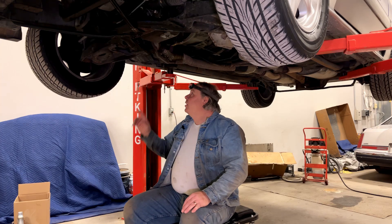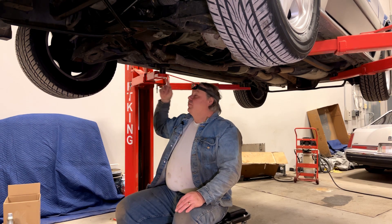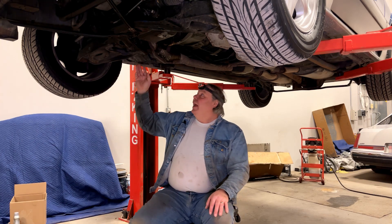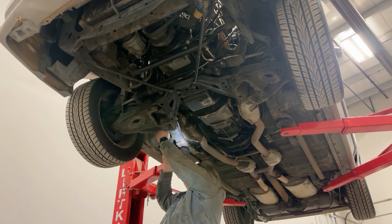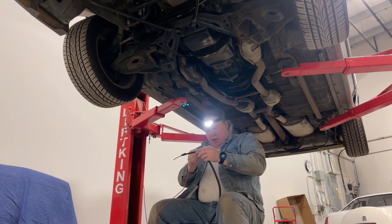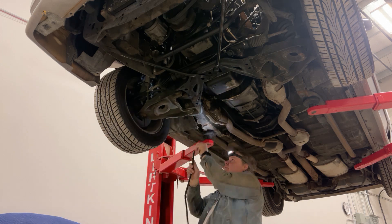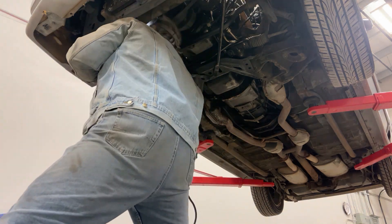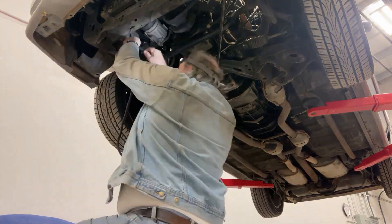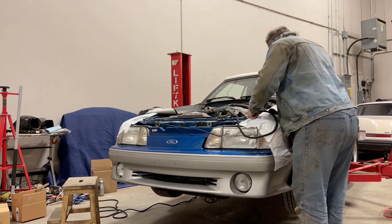Usually the best place to start is to feed the wire from the middle — feed it off the spool forward to the starter solenoid, then feed it to the back, where it's easier to measure just how much you need. Cut the wire, you don't waste that much, and you can start looming it from here forward. You have to pop a couple of plastic clips on the inner fender liner to feed the wiring through. Loom the new 10 gauge wire so that it doesn't chafe and tape the wire to the loom at the end to make it easier to pull through. Make sure you avoid any moving suspension parts. The wiring can run behind brake hard lines in the wheel well area, then follow the fuel lines back, then along the other harness in front of the radiator, and behind the battery to the starter solenoid area.